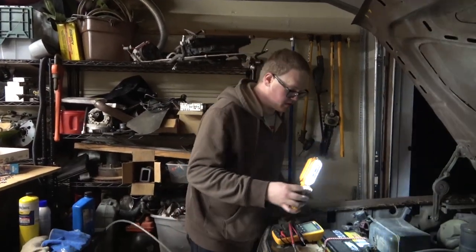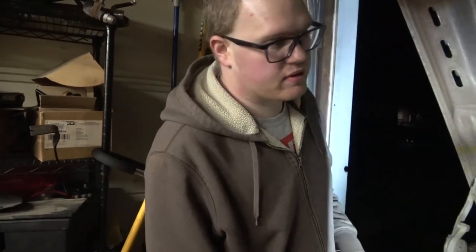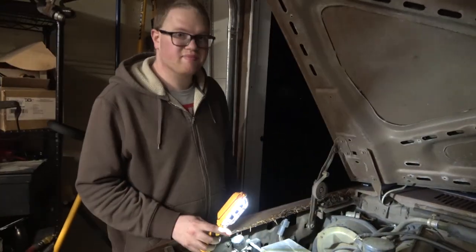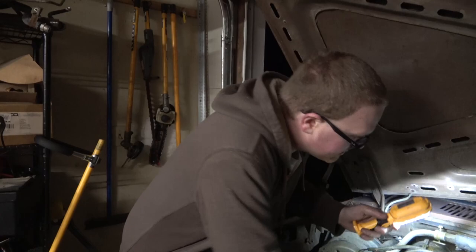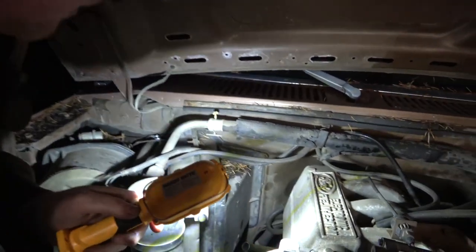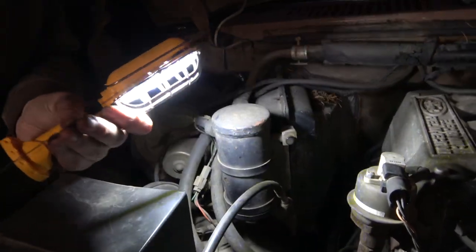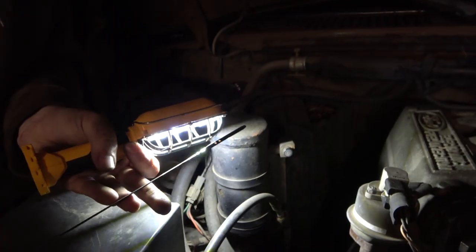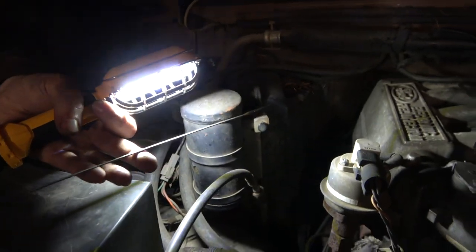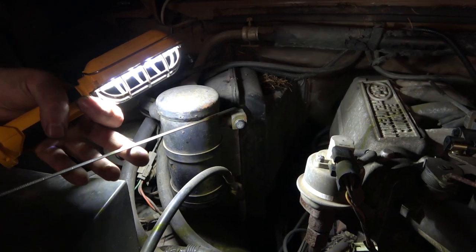We need to check the transmission fluid. And some people are gonna wonder, did you remove the drive shaft when you towed it? Anyways, got the dipstick tube, which is heavily mangled on the end there. Wow. Okay. What do we got here? Doesn't smell burnt. It looks like it probably could use a change. Yeah. Okay, so we'll be changing the transmission fluid.